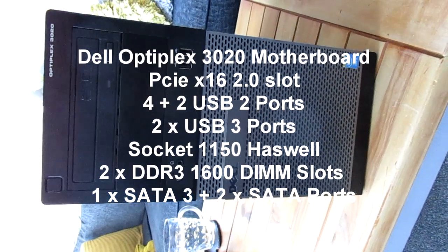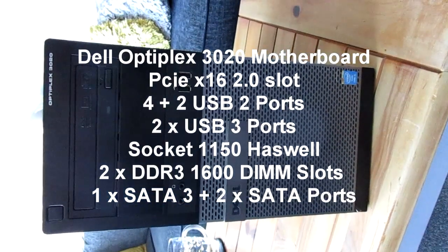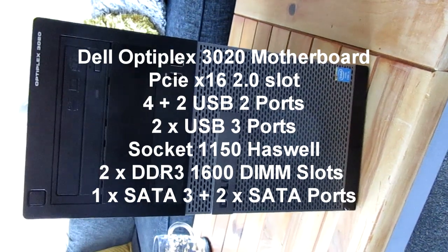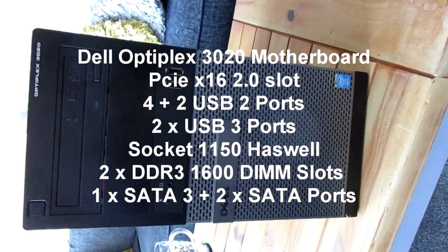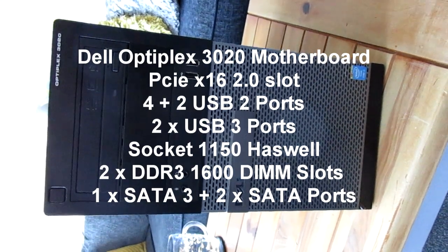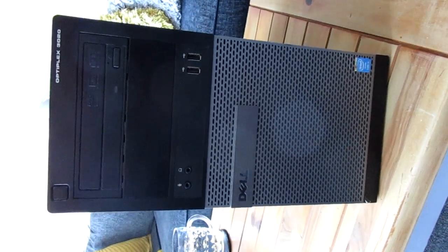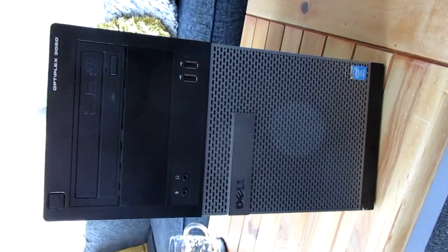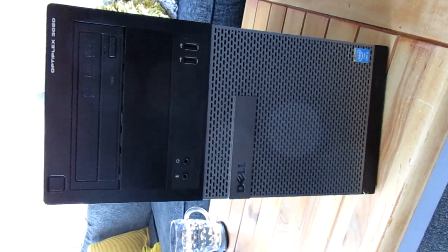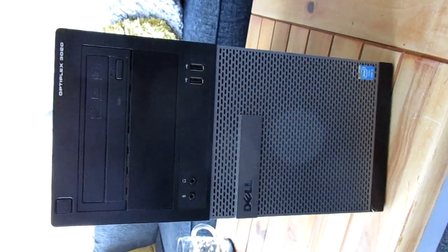They seem like you're going to get cooler temps, you're going to have the same amount of cores on these older ones, so I don't see any advantage to going for an i7. You're just going to cost yourself more money, probably have a hotter system. If, however, you know for sure you can turn the hyper-threading off, they're worth going for, because you do get a bit better quality silicon and more cache memory, which will help with gaming. But at the moment I can't say that you can turn the hyper-threading off, so my recommendation is to stick with the i5 processors regardless of what Optiplex you go for, if it's for gaming. If you're doing video editing, you want the hyper-threading, but for gaming, you don't.